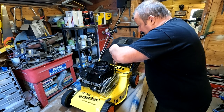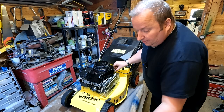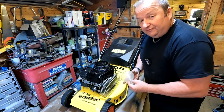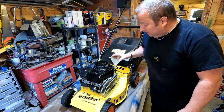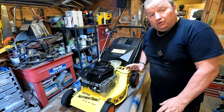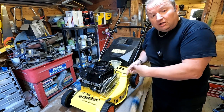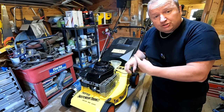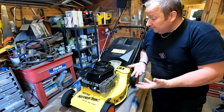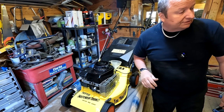And this takes probably about 500 millilitres of SAE 30 oil. To be honest with you, you can put any type of oil in here. I've seen videos where people run these things on vegetable oil, stuff you put in your chip fryer, and they go on and on. But car oil's obviously got more protection in it. But see, the thing is, there's no oilways in here. All you've got is a splash guard system from the sump that literally just lubricates everything. So realistically, there's no small tiny oilways to feed. There's no oil pump, no oil filter. So yeah, there we go.